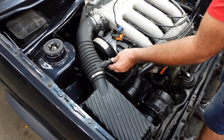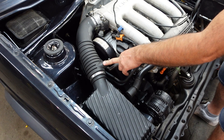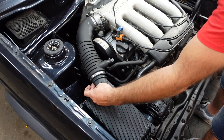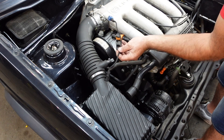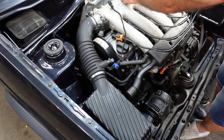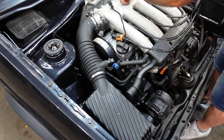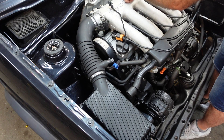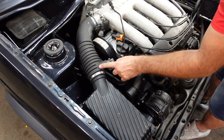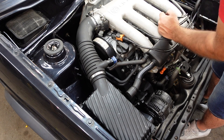I've had to put the air temp sensor into the air box - it's getting a little bit of flow but it's not in the main flow. My good friend Tim will probably be rolling his eyes watching this, because he says it needs to be in the inlet manifold - and he's right. On a standard ABF it actually sits on the air box, so I'm going to put this little adapter for now. At a later stage I'll get a 20-valve turbo air temp sensor - all you need to do is drill and tap a hole and it literally plugs into the inlet manifold. That would apparently be a lot more accurate.